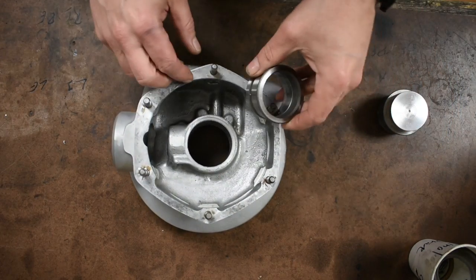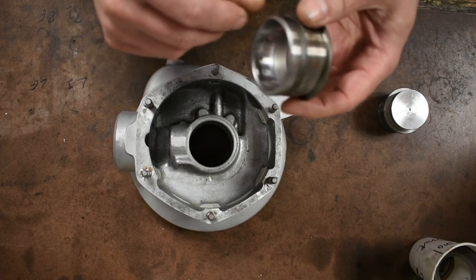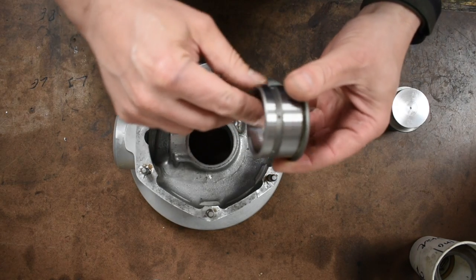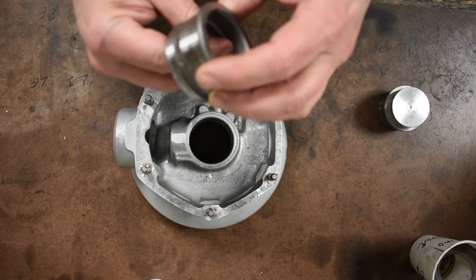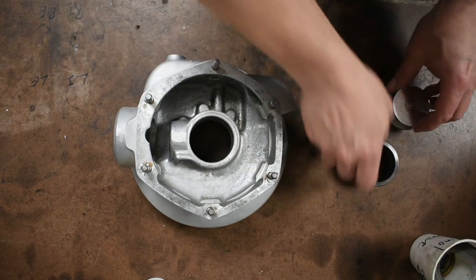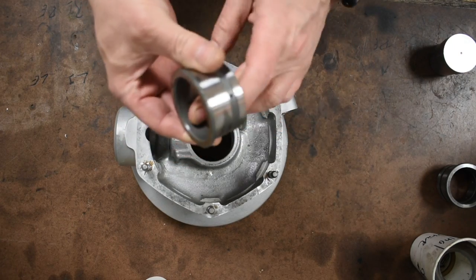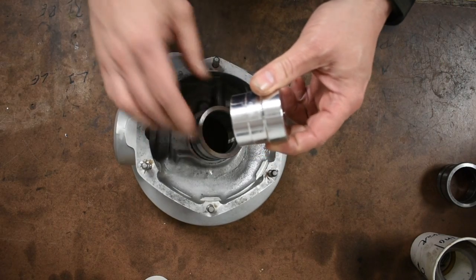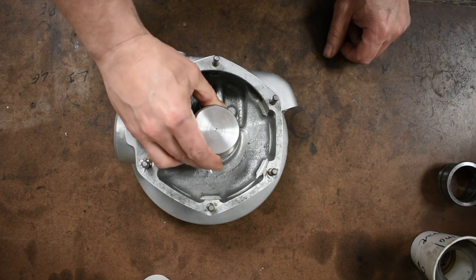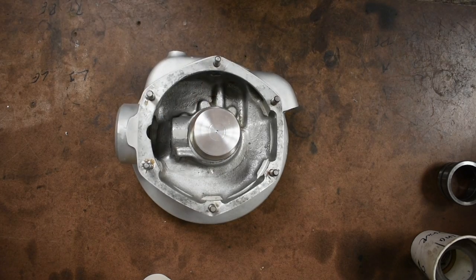Here's the final drive. When I was looking at the bearing bushing that goes in here, I saw that some of the chrome had started to come off — little pieces. It wasn't horrible, but I didn't like it. If I'm in here rebuilding it, I'm not putting that back in. So I got a brand new bushing. Looks perfect, feels perfect, everything's great. I made a special bushing pusher, going to heat this up and press that in on the press.